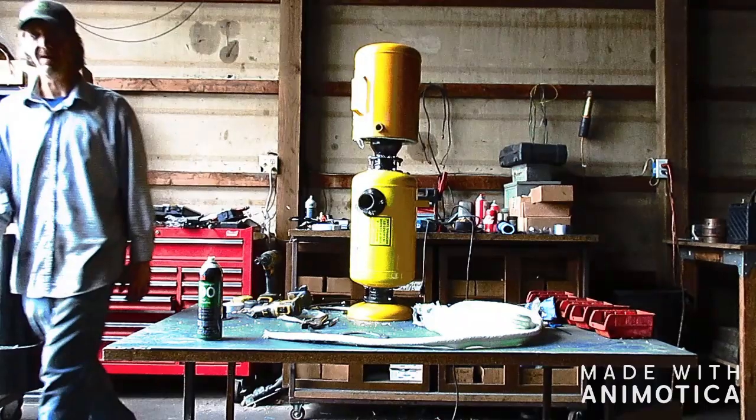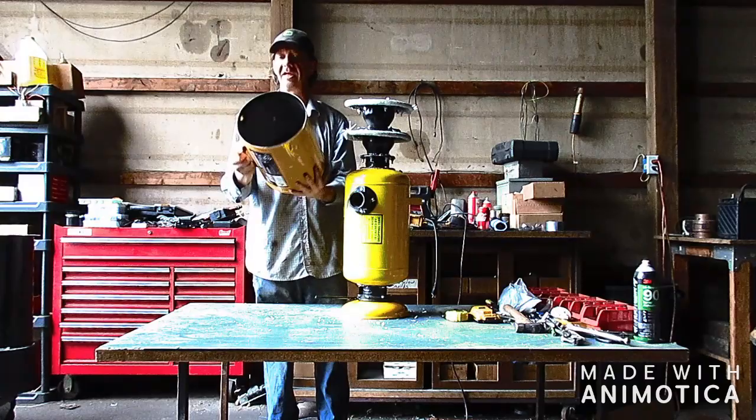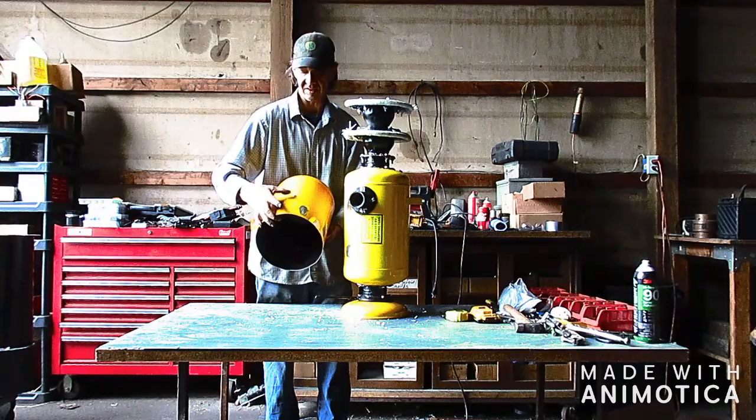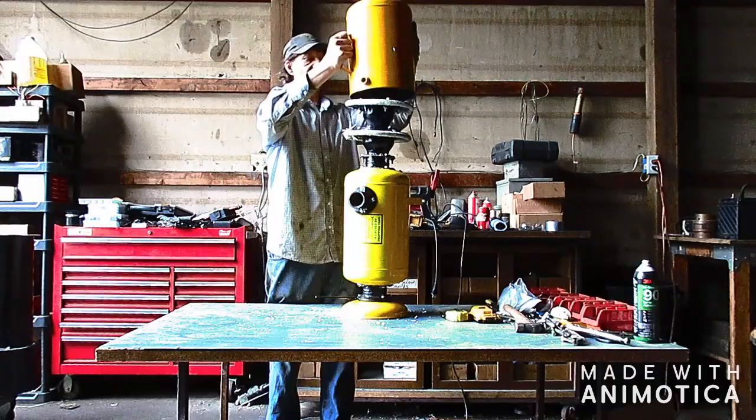Okay, so I got the hopper done. Pop this off here. You know, rather than make things complicated, just keep it simple. All they did is ran a couple bolts from each side to create the stop. These are located 5 1/4 inches from center to the edge. And that worked out perfect. And then as you see, I got the fill assembled.